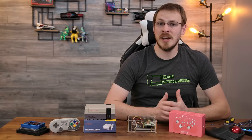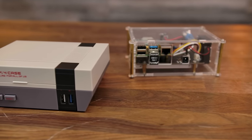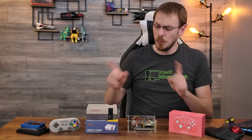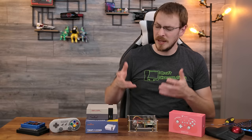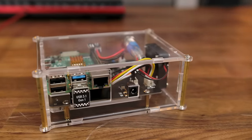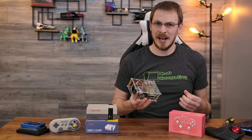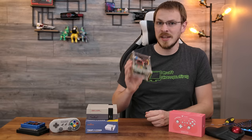After a quick lunch break while RetroPie installed onto RasPiOS, what do I think of this system as a whole? I love the NES Pi 4 case — this is a fantastic bit of kit that not only adds a ton of functionality to the Raspberry Pi, it does so with a good sturdy case and quite a bit of flair. The obvious contender to compare it to is the GeekPi X825. In this package, the X825 has pretty much the same functionality as the NES Pi case — a momentary power button with a safe shutdown script and the ability to mount a 2.5-inch SSD inside the case. The X825 does come with a cooling fan, but it's not directly over the Raspberry Pi, and it didn't even come with heatsinks, which I added separately.